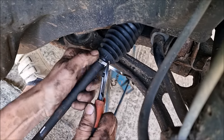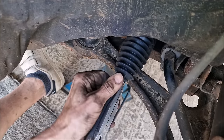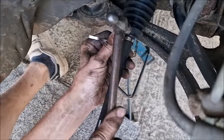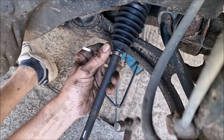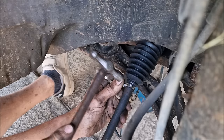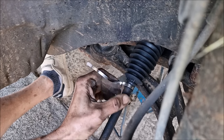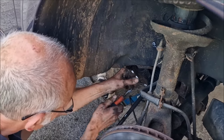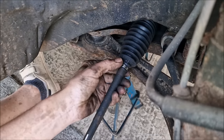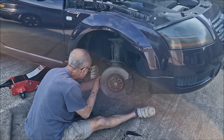There's a proper pair of pliers for this — be careful you don't damage your new boot, because it would be quite easy to. Got the little toffee hammer. Just cut that excess off now — if you leave a big tag sticking the wrong way, it can cut the boot when it goes into lock. Use the toffee hammer to make sure that edge isn't stuck up and sticking into the new boot.